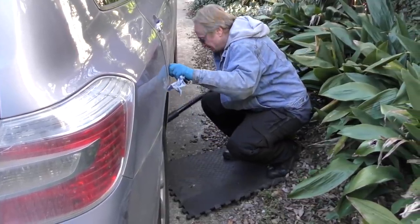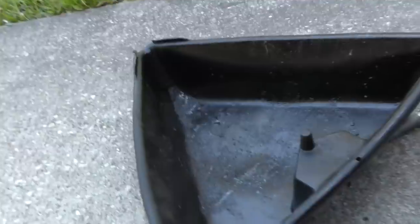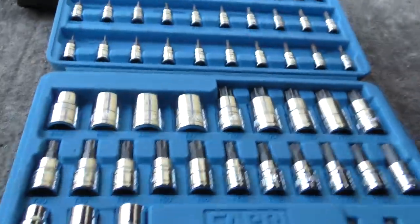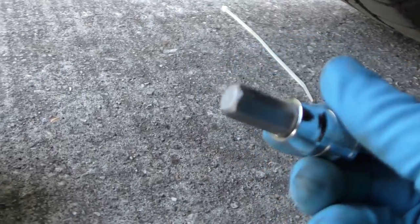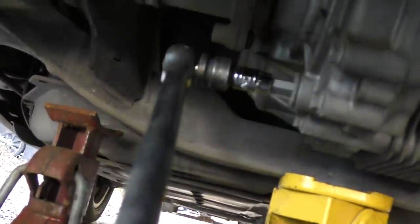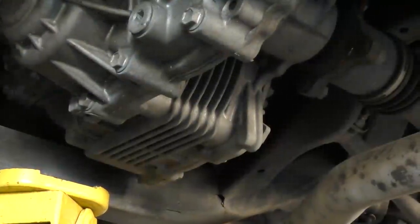So we'll jack it up in the air again, throw a big mat under there and a jack stand - under we go. Don't forget the drain pan, you got to drain it in something. Make sure you got the right socket - this is about every socket known to man, and in this case it's an H10 Allen socket. That's the drain hole - these are awful hard to get off, so you get a really long extension bar and then you can pop them loose. You just have to pull like mad. They take a while to snap sometimes, but once they snap you can do it with your finger - they just get so tight they kind of weld on, but then they just come right off.